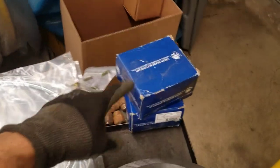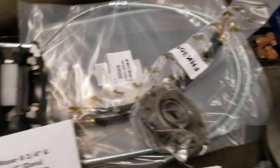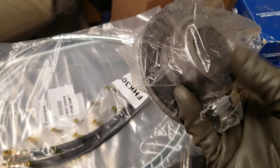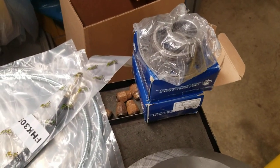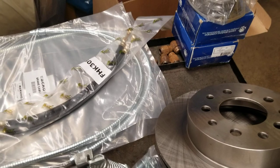The only thing I had to buy was these green bearings. You hear a lot of people talk about these green bearings — I'll show you what they are. They are a one-piece bearing with no race. They have an O-ring on them to seal, and it's got the keeper and everything on there in the flange. I'll show you when we get to that part. You need to install green bearings on these rear disc brake setups, because if you don't, the axle seals are going to leak. You can't put those factory adjustable style bearings in there.